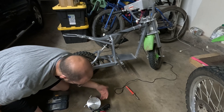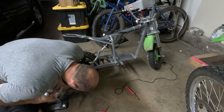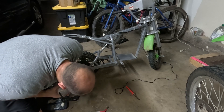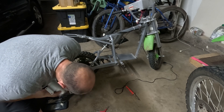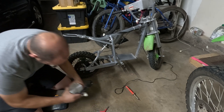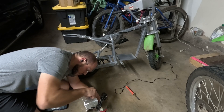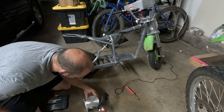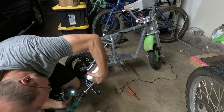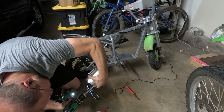This motor is awesome. It works perfectly with the SX500 with only slight modifications. What you need to do is recess the aluminum just a little bit so you can get those screws all the way in so they're flush to the aluminum. The aluminum is super easy to drill into and it's fairly thick, so you're gonna go about halfway down into the aluminum so you can sink that screw in all the way down.